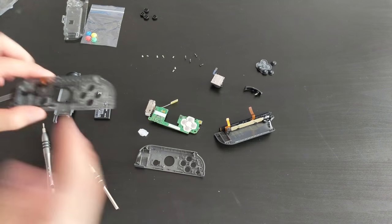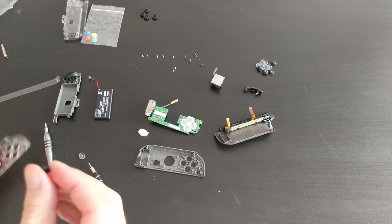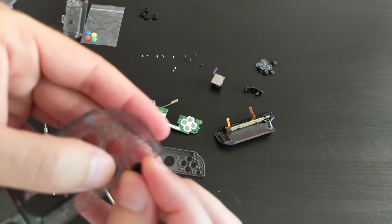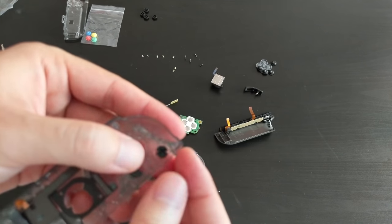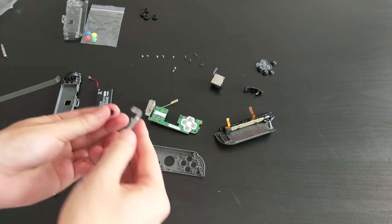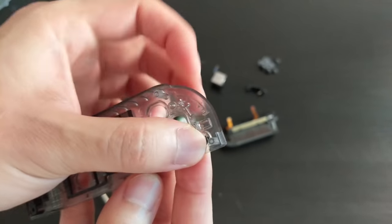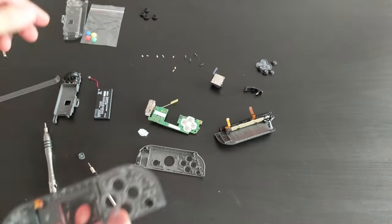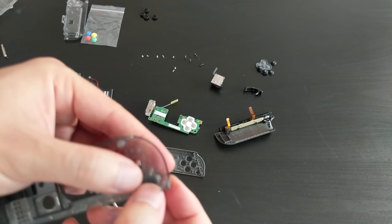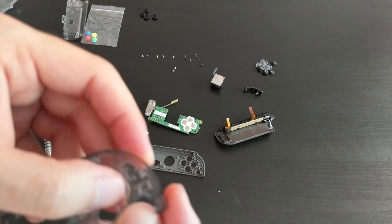I have no idea how I'm going to connect this ribbon cable back up, but we'll figure that out when we get there. Okay, so next, I'm going to retrieve my plus button. Okay, plus button retrieved. Going to pop this in. There's some notches in the two corners, so just make sure you line up the notches. That's not the right way. Notch in the top and the bottom. There we go. Now it's in. Now we put the plastic cover back on it. Plastic cover is on.